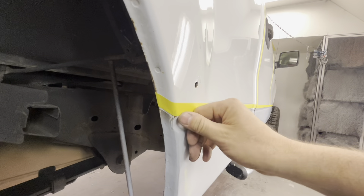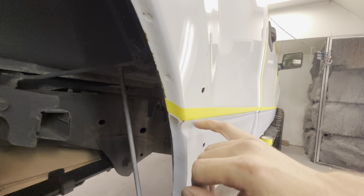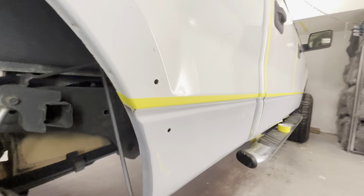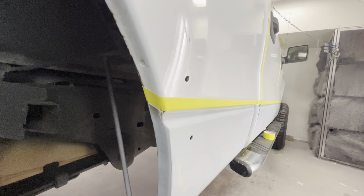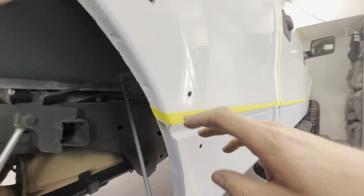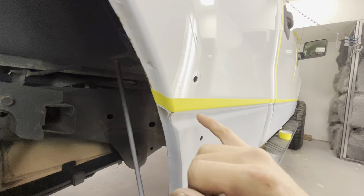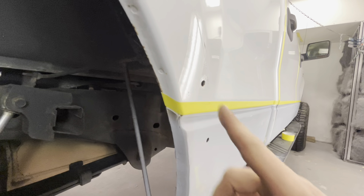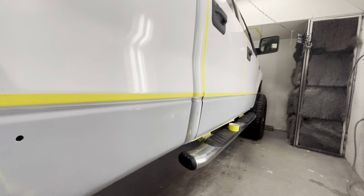They make a fine line tape. Traditionally when doing a two-tone job, you'll use a fine line tape and then yellow tape to get your tape perfectly in a line. I don't have fine line tape here right now, but you can go to your local paint supplier — it's almost like a pinstripe, a really fine vinyl tape that sticks really well. This can cause bleed-back where your paint gets underneath it, but I'm going to show you how to cut down on that chance.